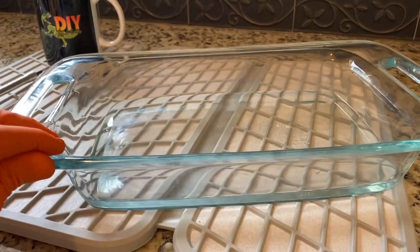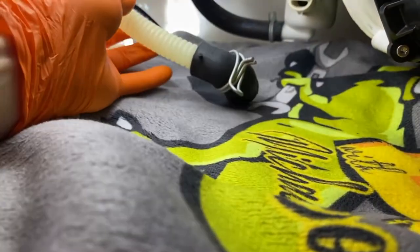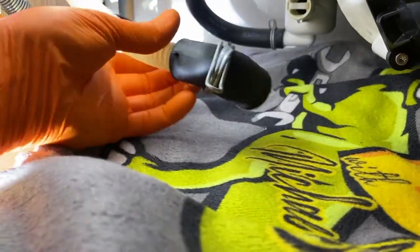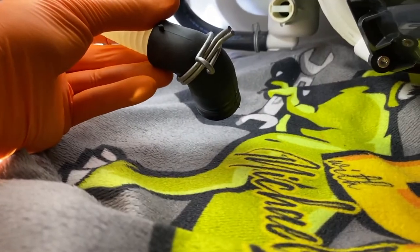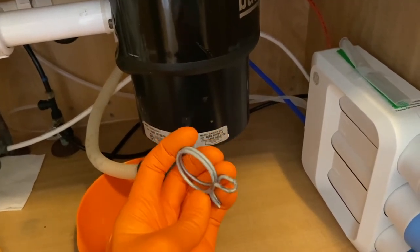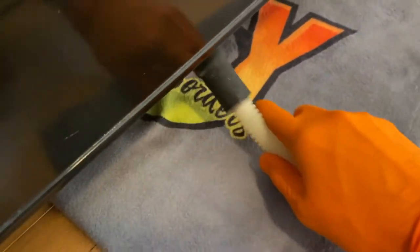Back up top — if you're curious how much water came out, not much at all. Going back down below, we are going to carefully pull the drain hose out from this side. Just be very careful. You may need to pull it a couple of inches on this end, go to the opposite side, feed it through, and continue this process until it's all the way through. There's the shape of this — a lot more unfriendly to get through a small hole than the other side. Back down below the sink, it's also important to remove the clamp that secures this side of the hose to the garbage disposal — that might not fit through that upper hole in a friendly manner. And I was surprised at how friendly this was to remove. And there it is.